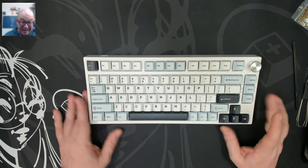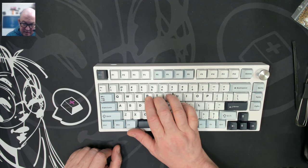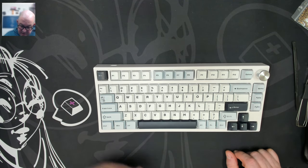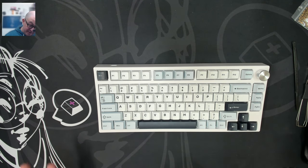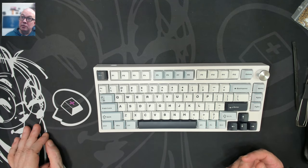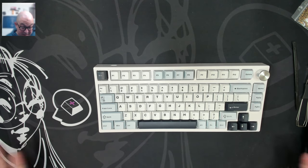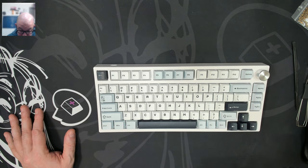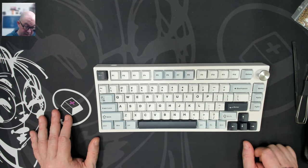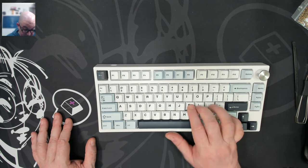Now, we do not have the hi-fi layers on this keyboard, and I think that's what's lending to a more raw kind of sound, if that's the right term for it. So this is definitely one of those keyboards that I'm going to come back to in the near future and see if we can mod it and make it sound good, because I do know there's a couple of the HE boards I'm taking a look at that do have the hi-fi layers, and they sound really nice. It's the same concept, there's just no pins going through them, so it actually would be a lot easier to apply the hi-fi mod with the PET sheet and the IXPE foam on top of it. And I think that would really make a difference.